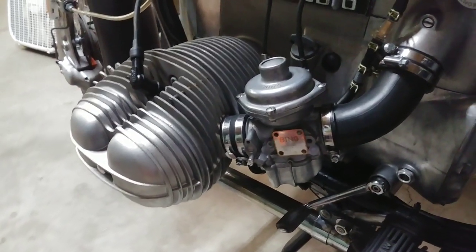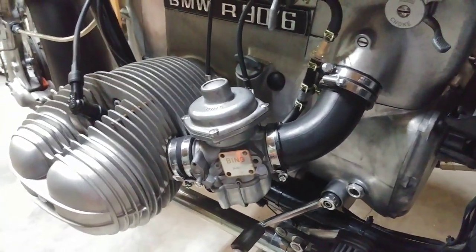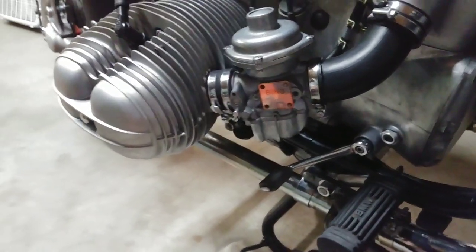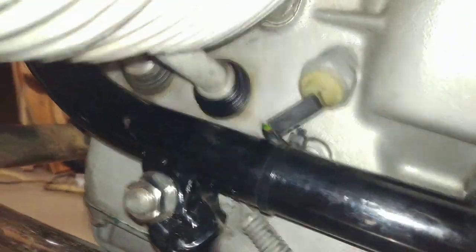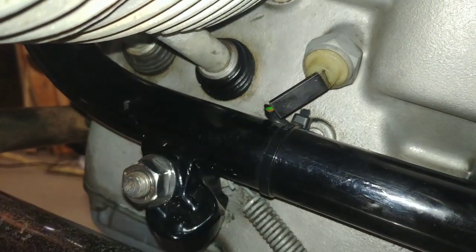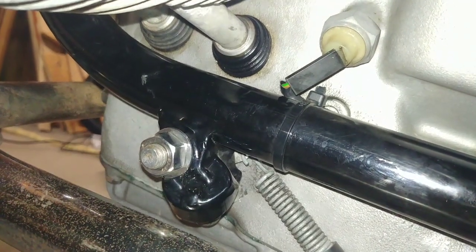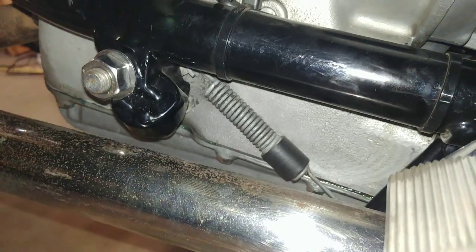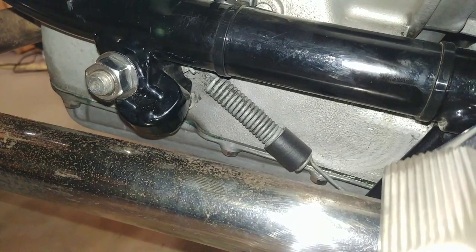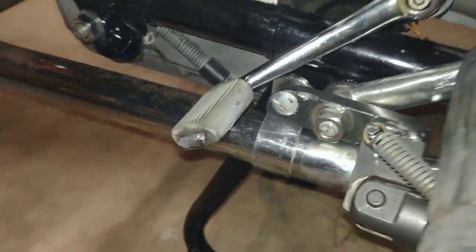There might be a very slow seep but I'm not in a hurry to do anything about it. The actual dripping leak that leaves a drop or two of oil every day is from a location I really have no idea what to do about. Down here you can see the push rod tube seal looks a little moist, but even after riding for an hour there's nothing coming out — just a little sweating. I already did the oil pan gasket, freshly re-torqued with stainless steel bolts and anti-seize so they won't seize in the cast aluminum. And today I did a really thorough cleanup and found where the oil is coming out.